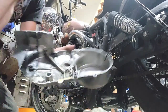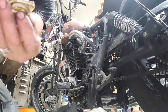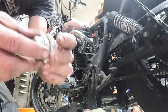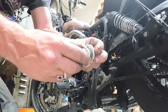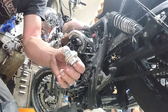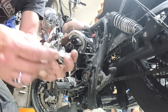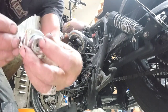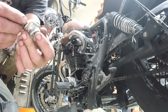Inside your stator cover here, in the little hollow in here, you have this — this is the exact one except this one's currently broken. This unbroken one is the exact mirror image, the threads are the exact opposite way. Also Yamaha bolts right in, it just turns the wrong direction. It gives you an idea of what's going on. Your original screw here — when you pull your clutch, this lever pulls on here, causes this to rotate. When it rotates in the housing, it pushes away from the housing.